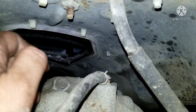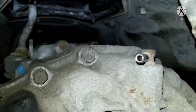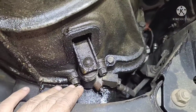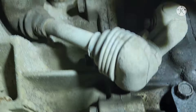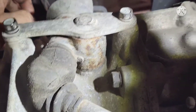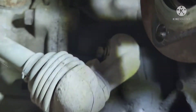Leave the clip on there for ease of assembly. You've got two 14s holding on the slave cylinder here. I had to take the exhaust out because it's going to give you a lot more room to remove things. Here's the four-wheel drive linkage - go ahead and get all these 12s loose, and then there's this 10mm here.